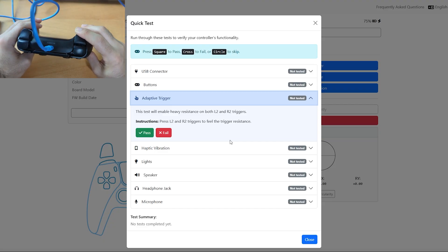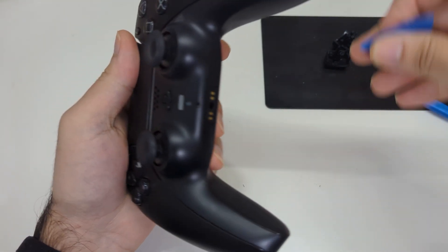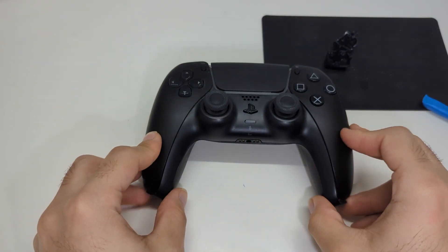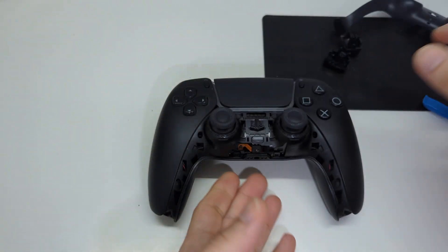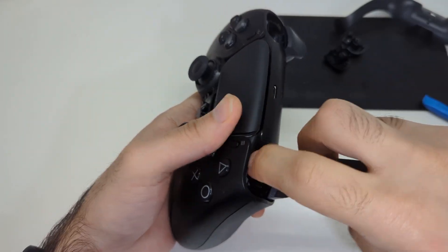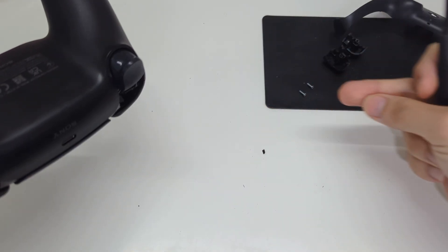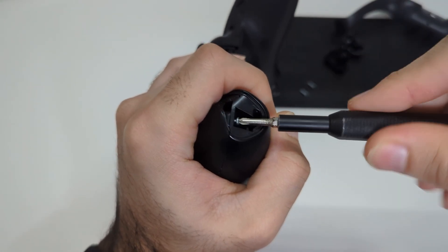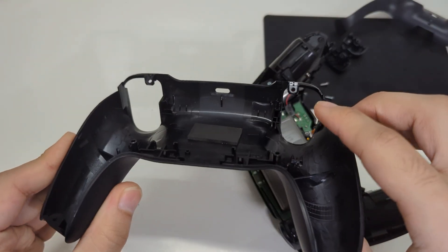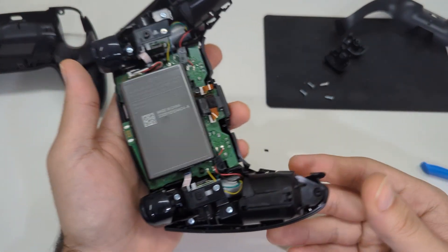It's not the springs because they seem to be intact. Let's open it up and see if we can fix it. I've done several DualSense disassemblies already so I'm not going to explain too much on the steps. There are just these four screws, and there was already a piece falling out — that's part of the rattling I heard. The back shell doesn't look too broken. It's probably only these clips missing, which always happens when you disassemble the controller and there's not really something you can do about that.